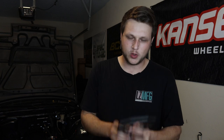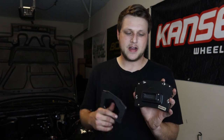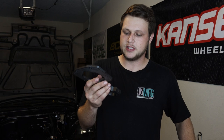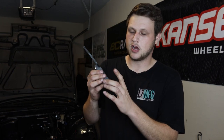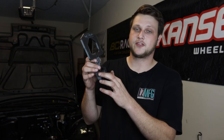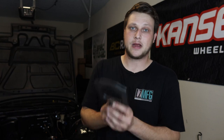I've always, always wanted a digital dash in the car and I finally have it. With this mount you have four mounting holes, and on the ADU-5 there are four studs and four nuts — you pretty much just sandwich it together. Then you clamp the mount to the steering column. You can talk to Daniel or check his site for the correct steering column size so you get a proper clamp without cracking or breaking anything. Let's go mount this thing.